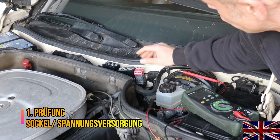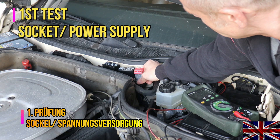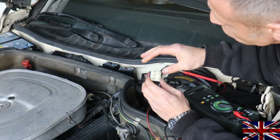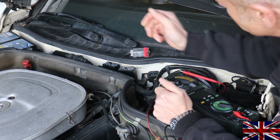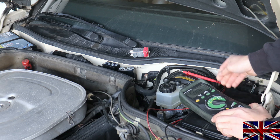Switch off the engine and gently pull it from the socket. This one has five poles — they are all numbered, so you can look up the schematics. You find the numbers imprinted at the socket as well. Take a multimeter, plug it into socket number 30 with plus, take the minus plug and touch some metal. The display should show around 12 volts, which is the case.